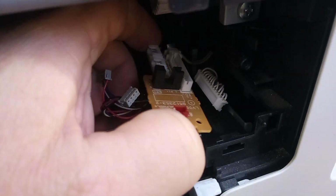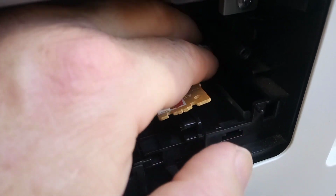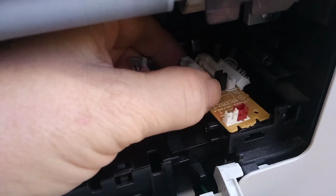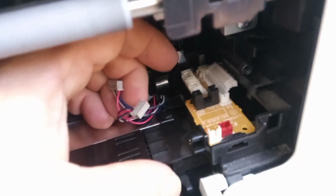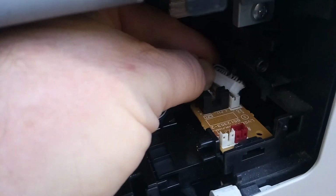Now my advice for the next step is to simply lock the circuit board in and then move on to putting the large plug in. So we will drop this board down here. We will clip it in at the front here first. There we go. And then we push it down and that clicks in, and it's locked by the clip at the back up there. So next we have to get the big socket in.